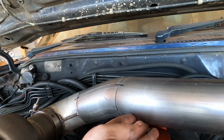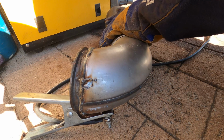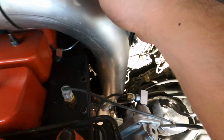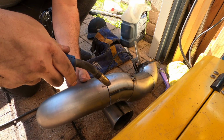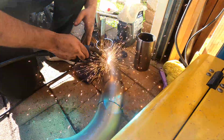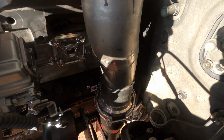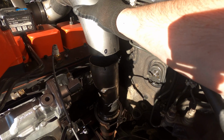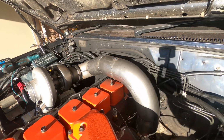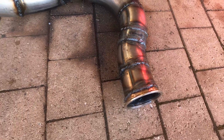It's not really necessary to make a template or design for building an exhaust like this. Using prefab bends makes it quite simple to just cut them to size, eyeball roughly where they need to go, tack weld them together and cut them to make adjustments if you need. The vertical section was the trickiest, but combining a couple of 45 degrees gave me quite a bit of flexibility in how to put it together. These welds are showroom quality.